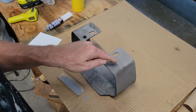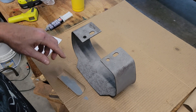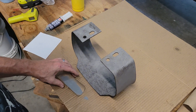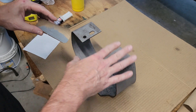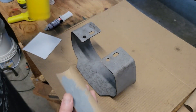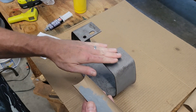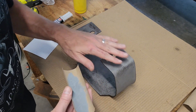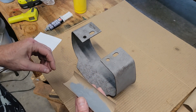I tried a little bit with some semi-gloss I have, and that didn't work out well for a couple of different reasons. So with this zinc primer, I'm going to try heating up only that spot from underneath with my propane torch — to kind of simulate just that spot being in the oven. That way I can mess around with the powder up here and try to get it where I want. I'm not going to try to do the whole area — just a little area, probably an inch in diameter, to see what happens.